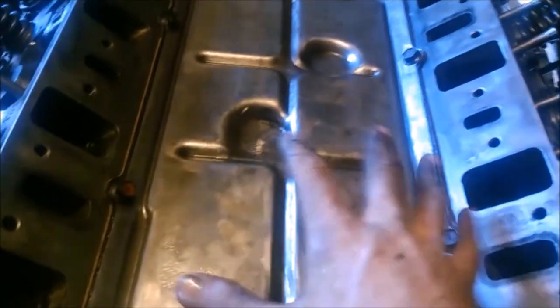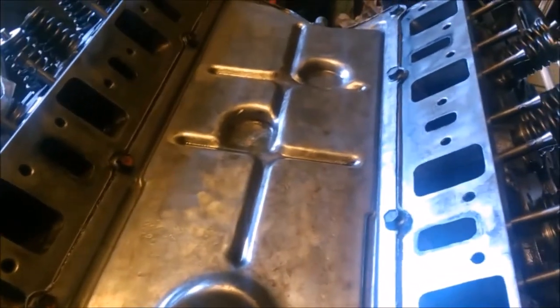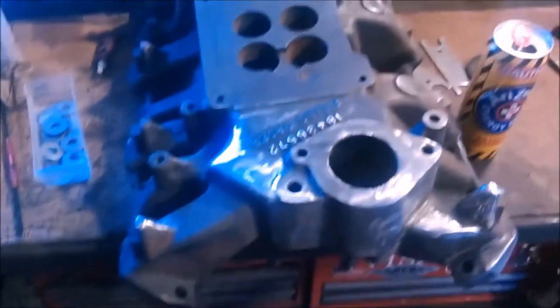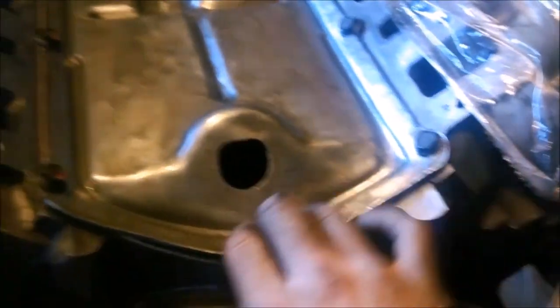We're going to mask this off and paint this lid in place once it settles up a little bit. Clean it with lacquer thinner and paint it because we won't be able to paint this when it's on. Same thing for the bottom side of our manifold — we'll paint that now since we can't get at it later. When you have two flat mating surfaces they don't need sealer — that's a hack fix. Also, paint parts before you put them down because paint won't stick to the silicone on the edge of the gasket.